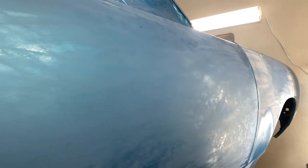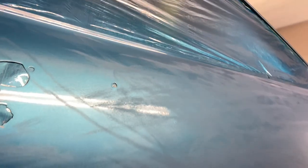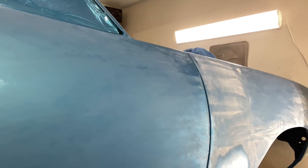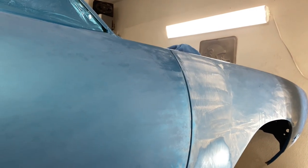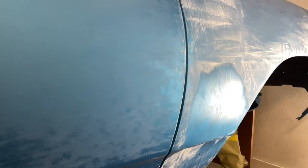If you look in the light you can see the shiny spots and the sanded spots. The shiny spots are going to be low spots and the sanded spots are the higher spots. I'll sand it at 45 degrees one way and 45 degrees the other way, with some straight strokes in between — just like body work. Dry it off and check it because you don't want to burn through. This car has about four coats of clear on it — it's a B5 blue Road Runner.